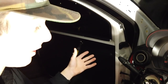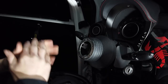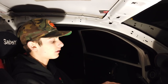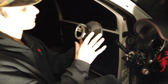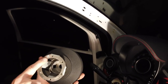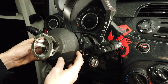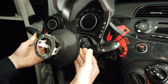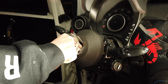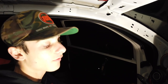So now we mount things. Once everything's unplugged, grab your hub. And if you get this Momo one — I'll put a link from where I got it, Amazon — it has a top arrow and it says 'top'. So you just get that lined up somewhat centered, and you push that on there. You're going to have space in the back, and then you get your nut and have fun getting it in there. I'm just going to go a little bit tighter than that.